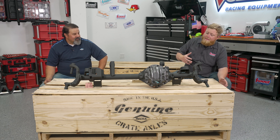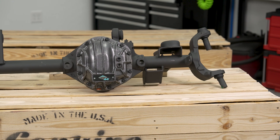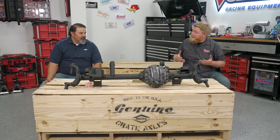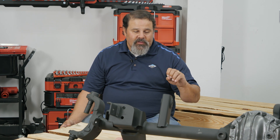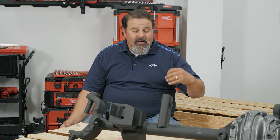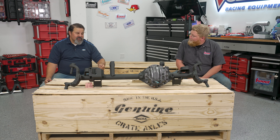This is a refined, upgraded version of a Dana 44. For those who have Rubicon axles with factory lockers and want to use their factory switches, Dana has figured that out. They have what they call a Rubicon integration circuit — it's different for JKs versus JLs and JTs but does essentially the same thing. It allows you to use aftermarket locking differentials that Dana puts in their Ultimate Dana 44 axles with your stock vehicle architecture, so you can use your stock switch to engage and disengage the locking differential.